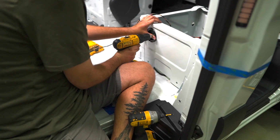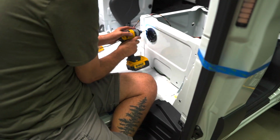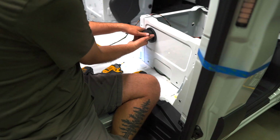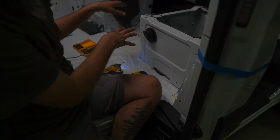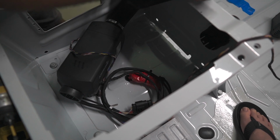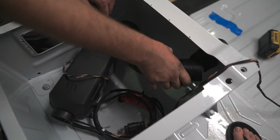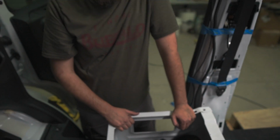It's a nice fit. That's the adjustable vent that you can turn and direct the heat. Once you get this piece installed, you can just snap it on there. And now we have an adjustable heat vent direction thing. Espar includes a hose clamp for this end of it, which I find kind of weird. They don't have a hose clamp for that end. It's kind of an edged piece, so it goes on and locks itself on. But I'm going to tighten that one down, route that to there, and the Espar for this portion of it is completely installed. And then we'll install the seat swivel.